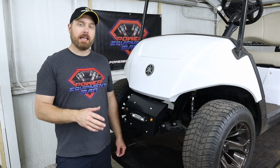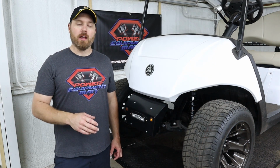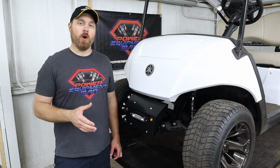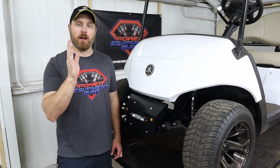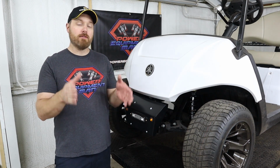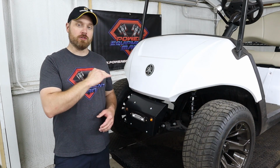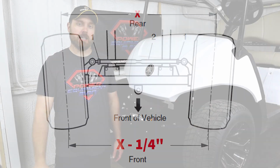Now once you've got that camber adjusted where it needs to be and everything tightened back down, then you'll need to adjust the toe of your cart. So the camber was the top to bottom of the tire. The toe is going to be the front to back of the tire. So we have another video that goes over just how to adjust the toe in and toe out on your tire, and I'll leave a link for that video in the description down below.